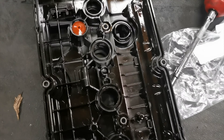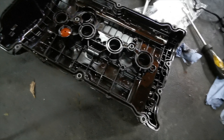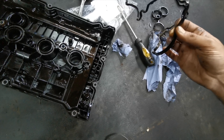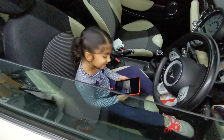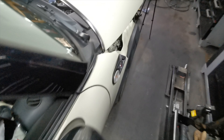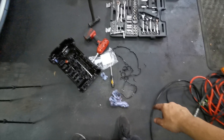Not as simple as I'd hoped to clean up. The gap is minute and there's oil all the way in the channels. Unfortunately I don't have any brake cleaner to hand, because I only want to do the job once. This gasket isn't too bad — it's not brittle or anything. However, whoever's installed it hasn't done it properly, so there's oil everywhere. I'm guessing it wasn't torqued down properly, or was over-torqued. The area is all semi sorted now — the gasket is right, it's just a massive spaghetti junction there.